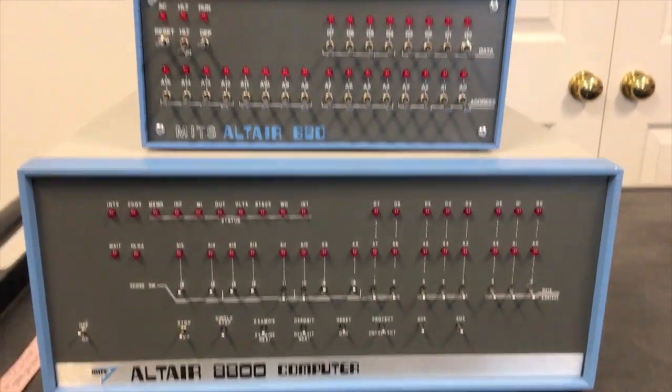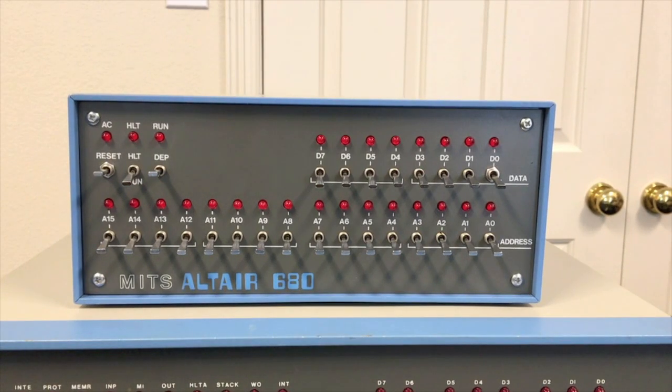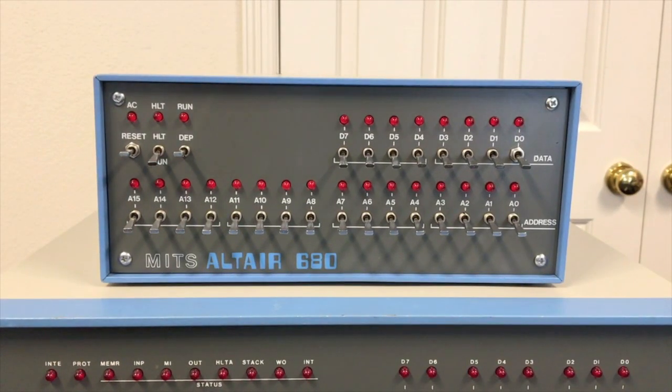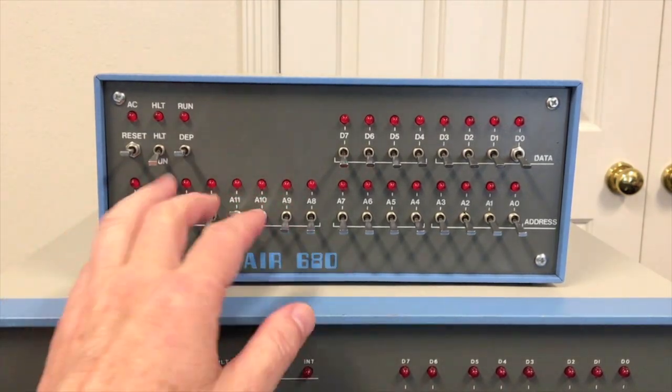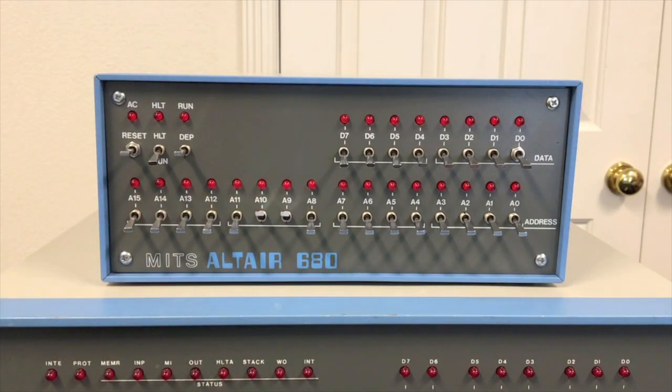So the question is: how do you do this on the 680? The answer is it can do none of those things we just demonstrated — not any of them. You can't set the program counter from the front panel; all it can do is run from zero. Anytime you depress run it starts from zero. It does not have an input port that can be read, so we can't do that trick with the upper eight switches. You can't stop the machine and see where it was. You can't single-step the processor, and if you wanted to jump to another address and run, you couldn't — because again, anytime you hit run it's going to start from zero.